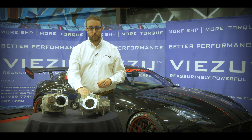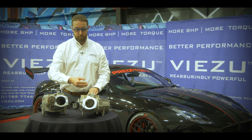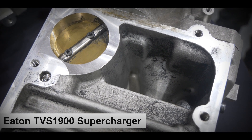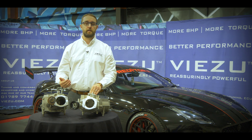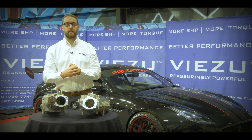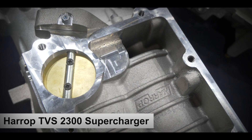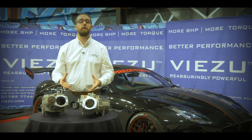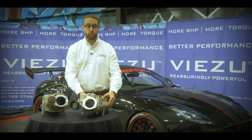Moving towards the front of the Charger and looking inside, you'll see there's barely any wasted space. On the standard Charger, there's quite a large void inside that isn't being utilised — the blades don't reach there, it's a smaller, shorter gear set, and it's effectively just wasted space. The TVS 2300 Harrop Charger makes use of all available space inside to get as much airflow and create as much potential boost pressure as needed for tuning, making this a really good upgrade.